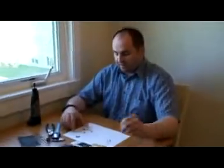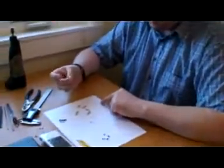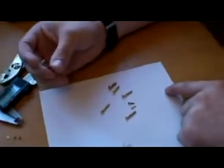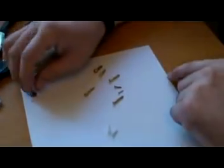Before you open its system, you have to decide what material you're going to use for the button, which way is going to make it. Basically, here I got some screws made from copper. I don't recommend using a nail made from steel, because it's a hard material and it's going to take you forever to grind it and make the right shape.